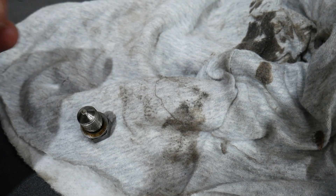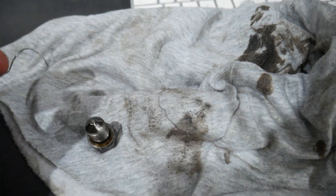So I've pulled the sump plug out and a thread has come with it, which is a little bit annoying. What I'm going to do for now is just put some sealant on it and put the old plug back in so I can carry on with the day. I really haven't got time to change the sump, and I haven't got one here anyway. I'll order a new sump and hopefully that'll come tomorrow or the next day. For now I'm going to continue with the service.